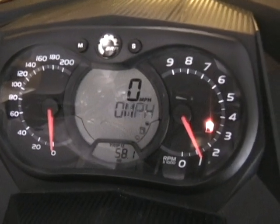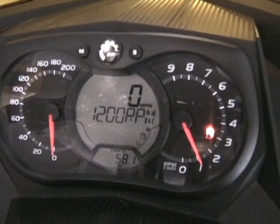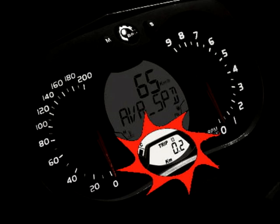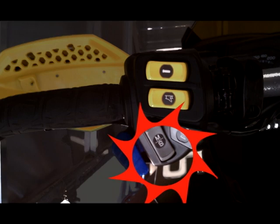The bottom panel also displays elevation and speed. Once your E-TEC engine has reached the proper temperature, you will need to have the odometer function selected on the smaller digital panel. You will then need to rapidly hit the high and low beam switch, which is on the left-hand side. While rapidly hitting that, you will need to press and hold the set button.